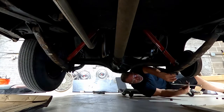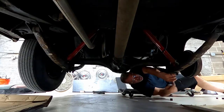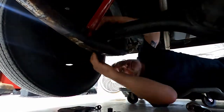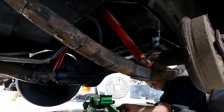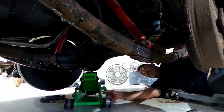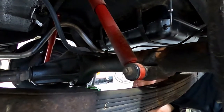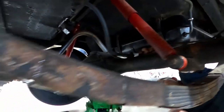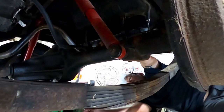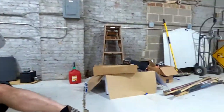Right now I'm taking the plate off the bottom of the spring — this should go pretty easily because I already loosened these bolts prior. We're raising the rear end — you can see we're getting separation from axle and spring, coming up higher on the driver's side, that's fine. We get approximately the right amount of separation — leave it there, locked in.